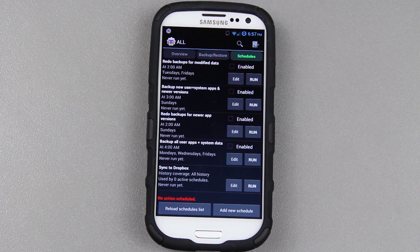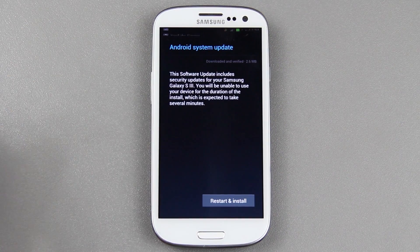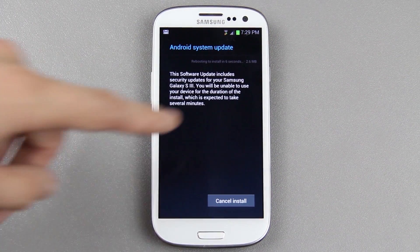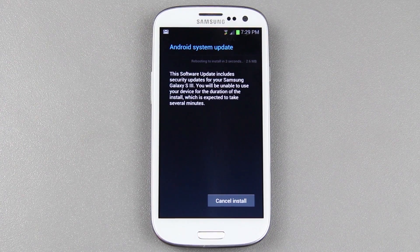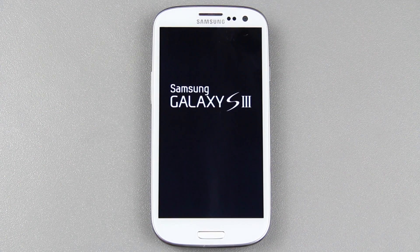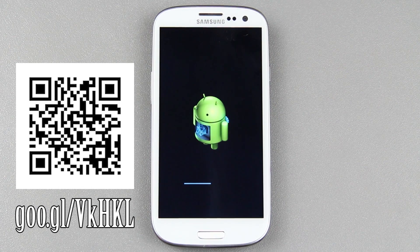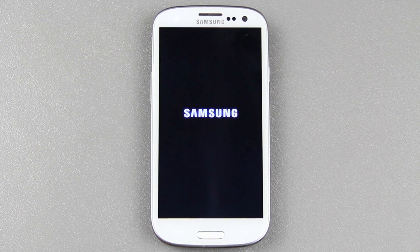The update is going to check your system directory and make sure everything is there and the way it should be before it actually lets you apply the update. I'll put links in the description to the video that shows you how to flash stock. I used MSkip's Toolkit, flashed it stock without wiping anything, then immediately rebooted into recovery and did a factory reset. Everything is completely 100% stock, and I reset my flash counter to zero using TriangleAway. This phone is completely 100% stock, as if I took it from the Sprint store and just unboxed it.